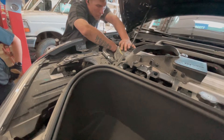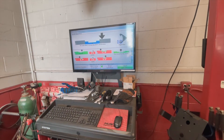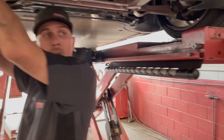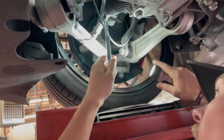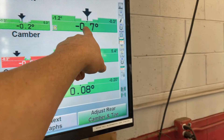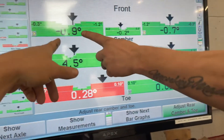It takes quite a few turns to get that thing to move. Now adjusting camber, trying to get that to negative one. The final part is adjusting toe. That's the one I'll have to adjust — it's a little too far. We're going to back it in a little bit. What are we trying to set toe to? 0.08. And camber with me in it goes to 0.9.